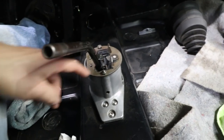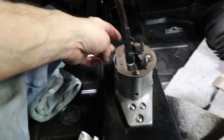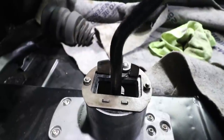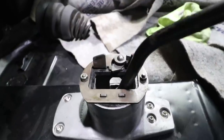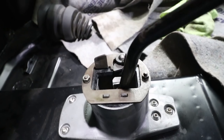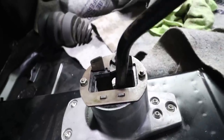What I was talking about earlier is the distance between the shifter and this housing — it's less than a pinky width there. When it's in first gear, it's even smaller than a pinky width. Here's neutral — vertical — and first, it's pretty close to the stop but it doesn't hit it. Second is also pretty close to the stop, but it's a little closer on that side. I'd say if any of the gears has trouble, second has the most trouble going in.